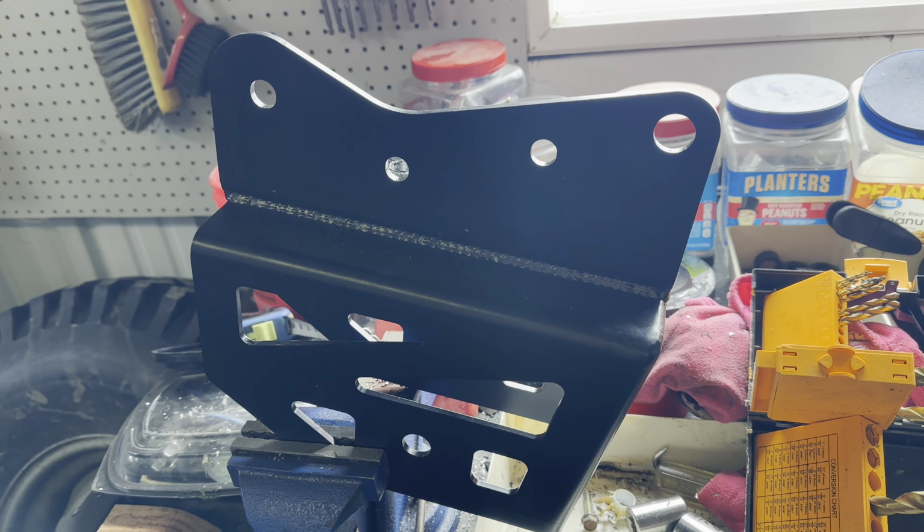And my idea is that that's going to keep it from ever rusting, because there's no way the grease will wash off. And this whole crossmember, or this whole frame, is oily, so there's no way paint's gonna stick to it. So I'll just take a nice big glob of it, like so, and then just smear it around. Just wherever that mount's gonna touch, just cover that because it'll keep it from rusting. People use grease all the time to keep things from rusting.